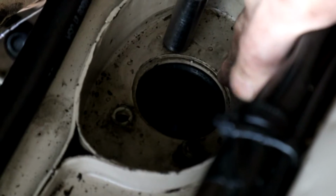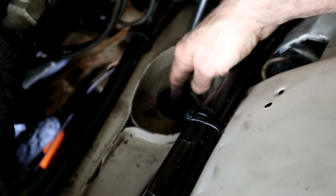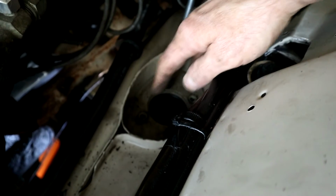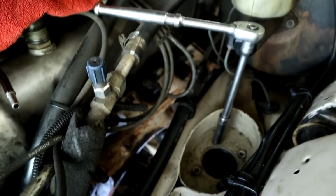So we'll just do these 4 bolts up, and then we'll put our support plate back through so that we can keep the subframe low, so we can do the other side. And in actual fact, what I'm going to do is not put the new center bolts in until we've got everything else anchored. Even the car can go back on the ground, then we can put the final bolts in. So anyway, let me get these bolted on and we'll do the other side.